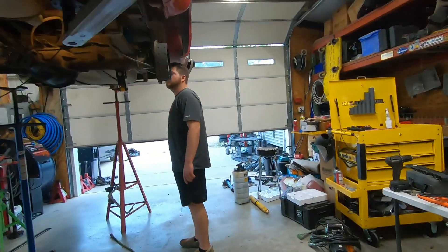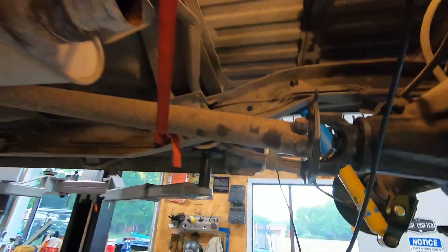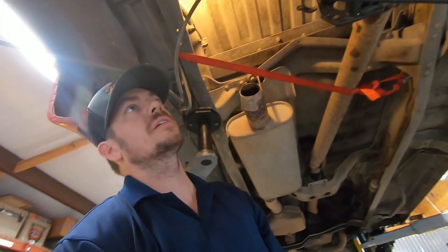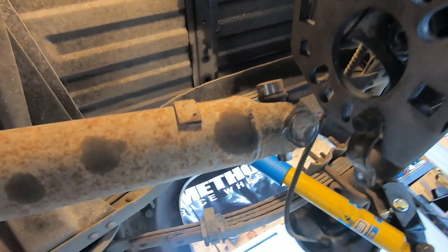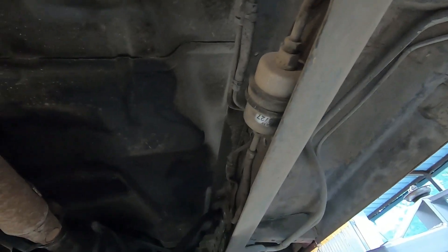Jared, nice for you to join us. It looks really nice — pretty nice, eh? Right now I'm going to pull the drive shaft out while Jared's finishing up the center section with the new 3.73s. Get a little horse ponies. I'm going to yank the drive shaft out, try to put a new carrier bearing in. This U-joint came apart when we took the pinion out — no bueno. And I'm also going to slap in a new fuel filter and a new transmission output seal. It's kind of dark in here, but anyways — every day we're hustling. Time to get to work.